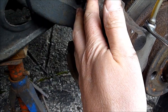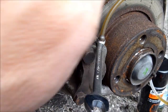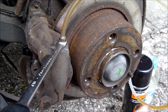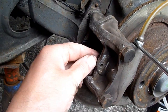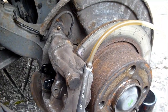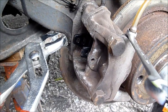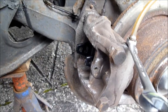Grease everything up, put the cover on. I'm just going to bleed a bit more — switch the engine on and bleed any air out of the brakes. Make sure everything works. Clean the disc up, make sure everything's fine. And that's it basically. It's a very easy job to do, anyone can do it. Sometimes the only problems you'll get is you can't get them out, but if you use a pair of these pliers to pull them out — that's the way I've done it in the past.